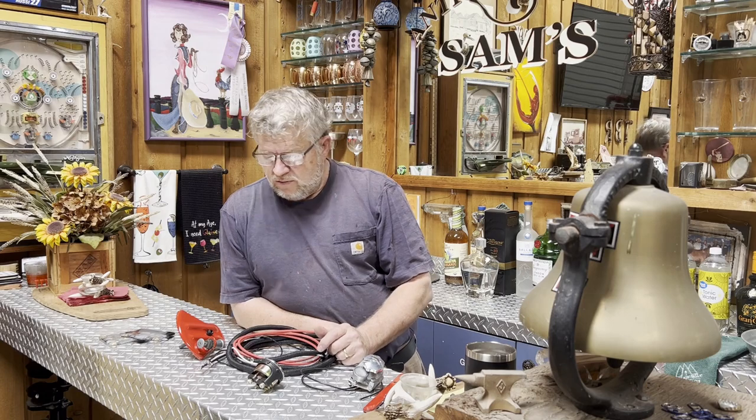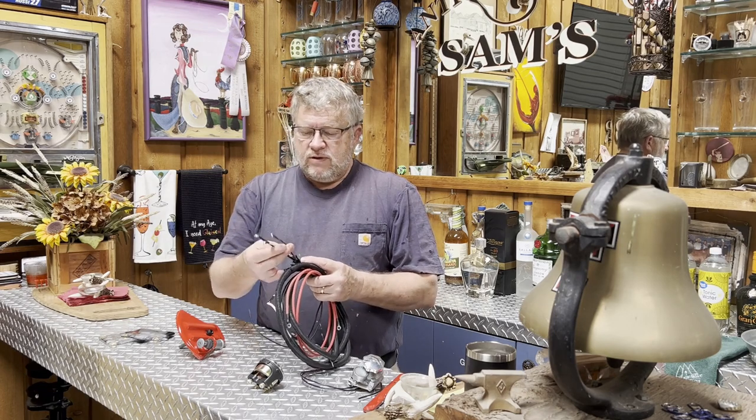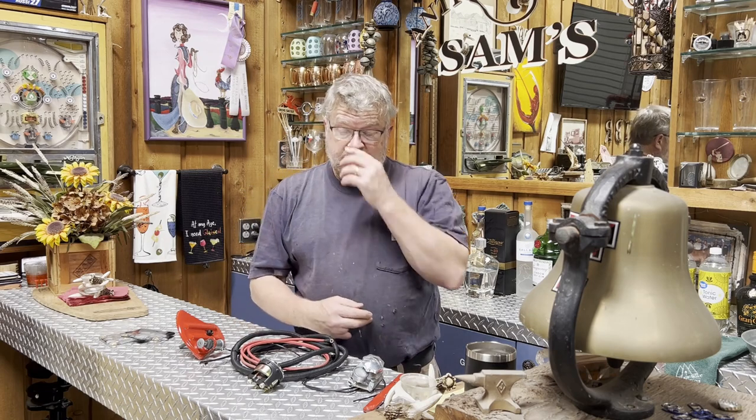And the wire was about 15 bucks a roll times, I think, about five rolls to get the different gauges and colors. You really don't necessarily have to have colors. I tried to match up the proper wire, but the only thing you see, these were black wires, and the only thing you see of this is about 4 inches of the white wire. So I'm not sure it's worth spending a whole lot of money to get the white with red tracer and white with black tracer wire that looks like came on the original harness. At least that's the one that I have, because you really don't see any of it if you put it in a loom.